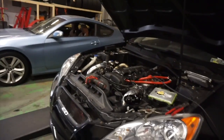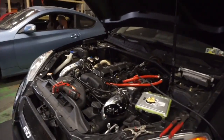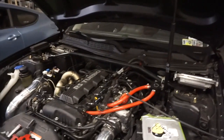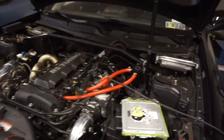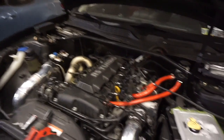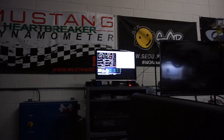Double-checked for leaks and set up the car on the dyno. Just swapped out the injectors, so now it's on Deatschwerks — DW — 750 injectors. I have my base map for the 750s and I'm going to start tuning from there.